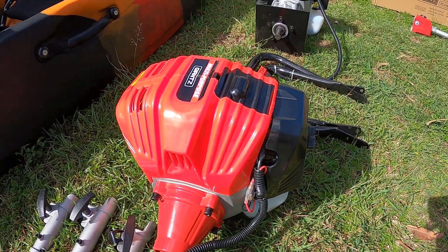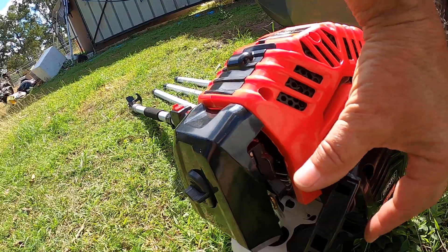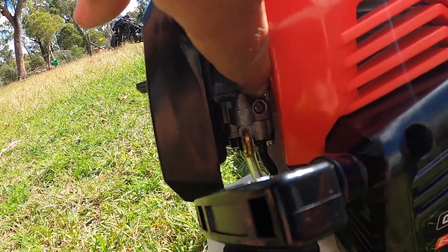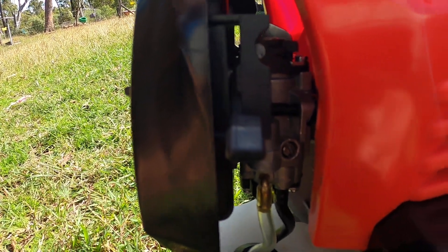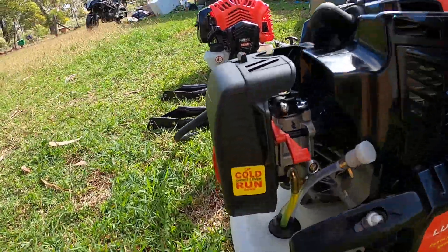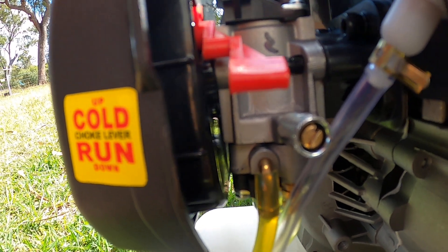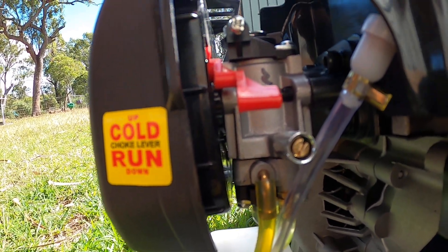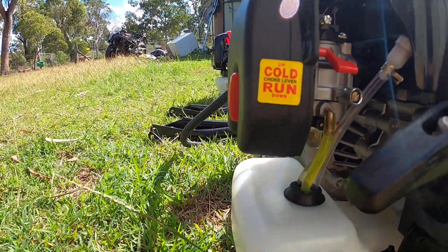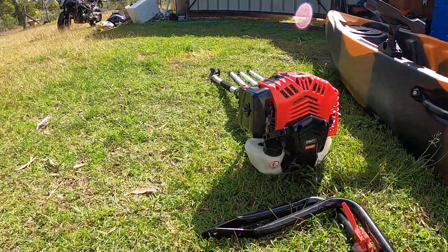This Giants is only 65cc so I'm going to run the 86cc motor with that prop. I already modified it - you can see here where the air screw is, I had to dig it out and cut a little groove in it with a Dremel to tune the carburetor. I've done exactly the same with this one. I turned the air screw out - it was a bit of a struggle but I got it out and made a little groove with the Dremel. I'm running these motors with a 50 to 1 fuel to oil ratio and never had any issues.